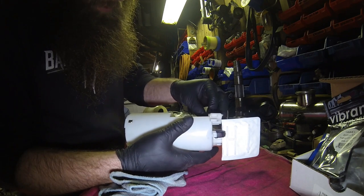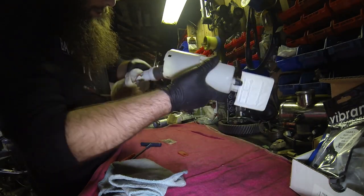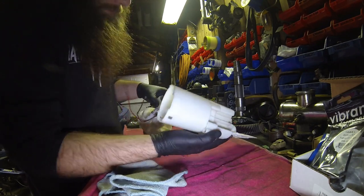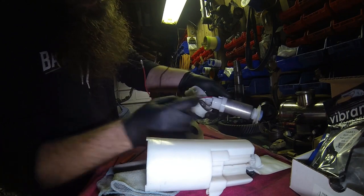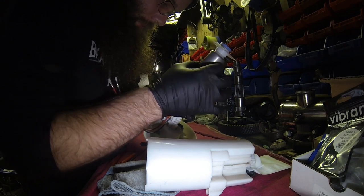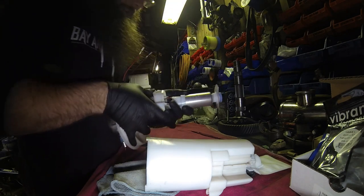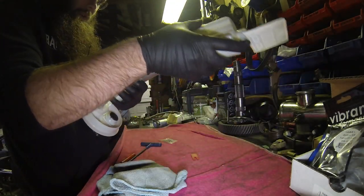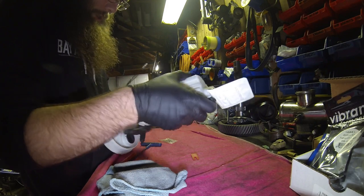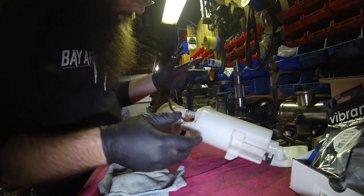That can slide off too if you got the sending unit still out of it, so you gotta make sure you put your hand on that. But anyway, what you're gonna do is take that triangle spot here that lines up for the sending unit, and then line that up to the triangle spot cut in the hat, put your pump back in, line it back up. Go ahead and slip your pump back in. Pump will fall into that spot. Shove it all back together. Put your connectors back in. We'll show that at the end of the video.